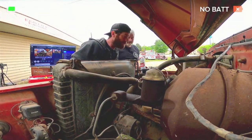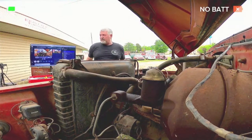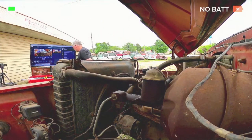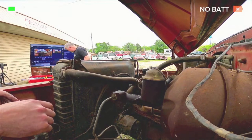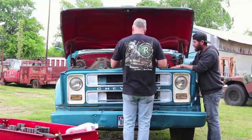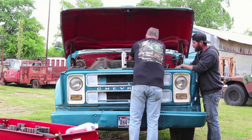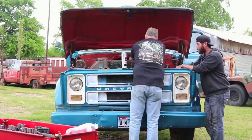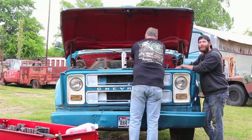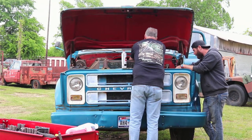Well, you want to get some? Yep. Let's see if we can keep it. Let me go ahead and fill that bowl up again a little bit with some gas. We're going to try to crank it again, and Dad's got some carb cleaner here. We're going to try to keep it running, maybe idle for a little bit, and then attempt to possibly hook us a gas tank up here and see if this fuel pump's going to pump up to the carburetor and see what it does.